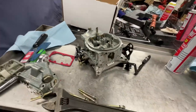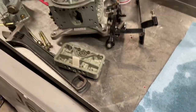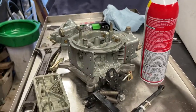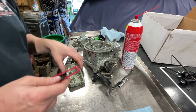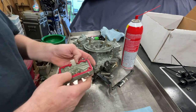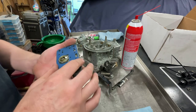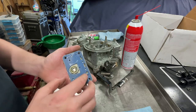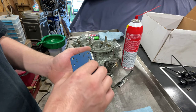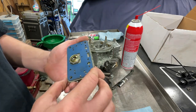There you have it — some kind of cloudy milky sediment that came out when I completely hosed the inside of the carburetor down prior to reassembly. Reassembly is just as easy as taking it apart. Gaskets are reusable if you don't ruin them. I got a new one for the other side because the old one got stuck. Note there's an offset pin on a Holley — I tried to put it on one way and the holes mostly lined up but not really. Flipped it over and now the pins go through the gasket properly.